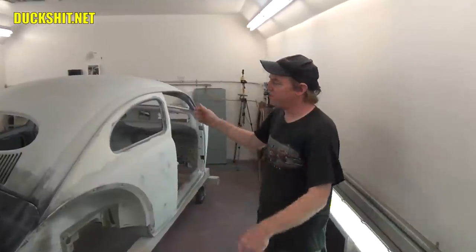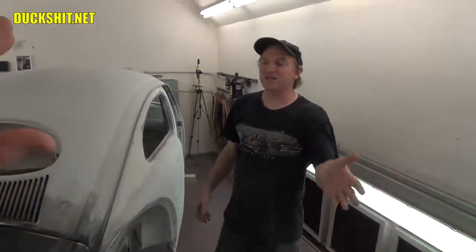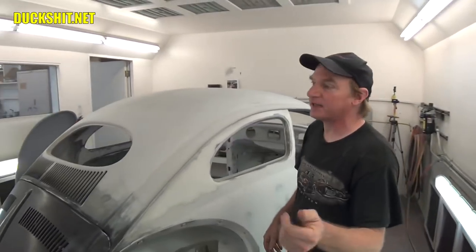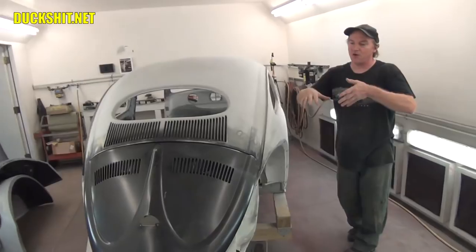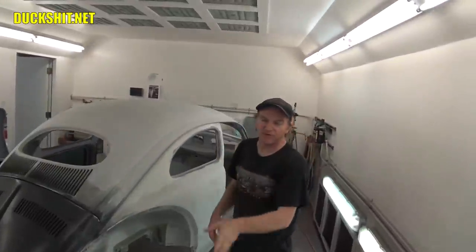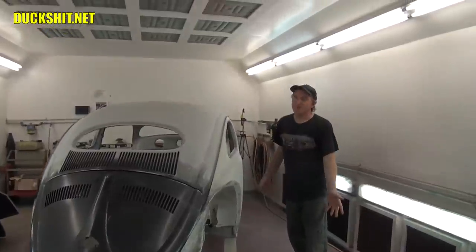It's the humidity changing the material. It's made with talc, and it's got polyester resins in it, and it just reacts with the environment. Now, is it also because of the volatile chemicals evaporating and shrinking back a little bit? When you shoot the primer, like this high build, super build 4-to-1, that's exactly what it is. You shoot that on there, the initial hit, transfer, dieback, is chemical release, and then as it goes, it just does a little bit of changing. If I was to block it out and then body paint real fast within a week, you're going to see a lot of stuff show up. You don't want that. Let it go back for a little bit. Take your time with it. You'll have a better result.